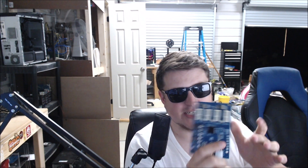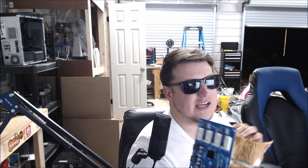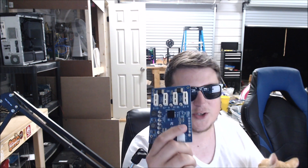Then I stepped up and found these — you run a M.2 slot on your motherboard, then run a USB cable out to this daughter board, plug in six-pin power, it's got a PLX switching chip on it, and then you have four risers going out. So you could essentially leave one USB M.2 adapter inside your computer, run a USB cable out, and have all this stuff on the outside of your actual rig. But it didn't add any extra functionality, so I kept digging.